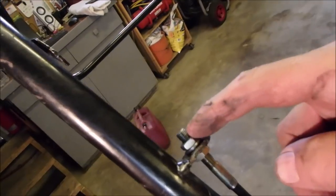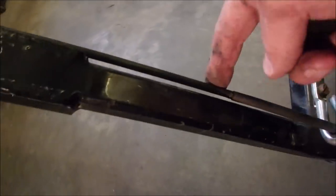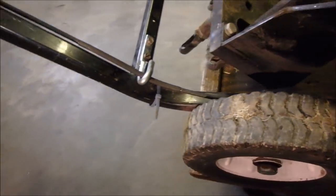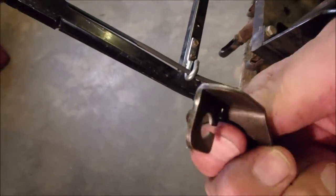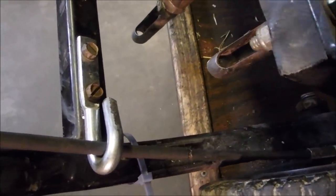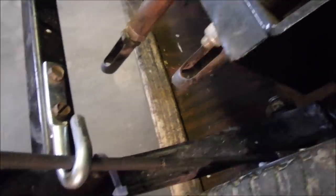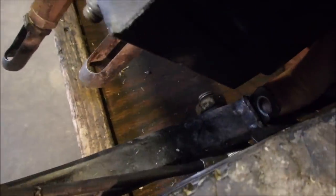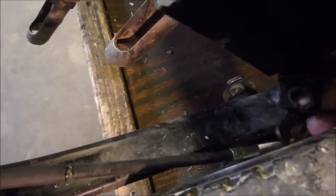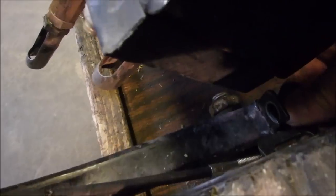We're working on this aerator. This is my new cable — it's going to mount there. I put a heat shrink sleeve from here to here, just to keep it from getting chafed. And I'm going to cut that off so I just have the L there, and then that is going to sit in there like that. I've got a hunch there was one of these brackets on here before that was sitting up like this, and somebody whacked it off with a grinder, because this is suspiciously looking like the same cable.